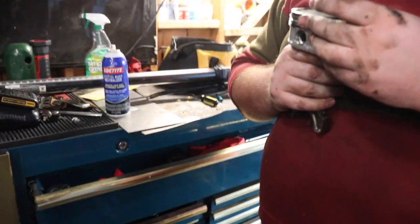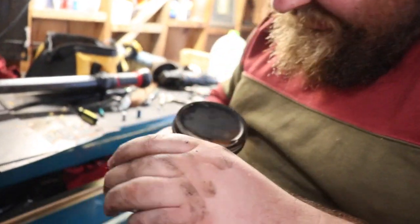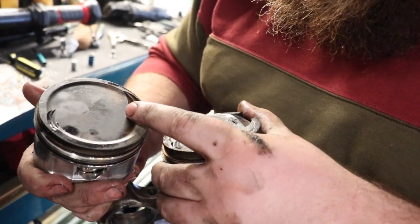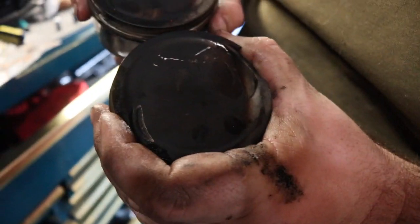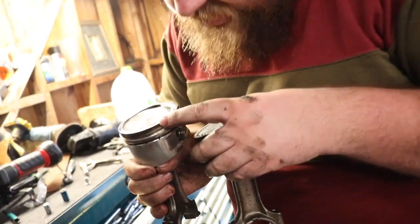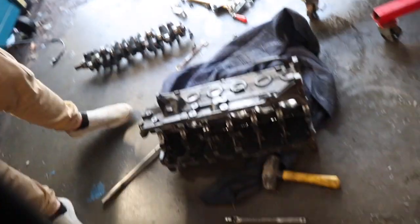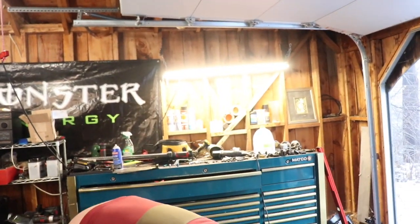Interesting — your valves had hit at some point. Are they all like that? No, see this one? There's a huge divot there and there isn't over here. This one definitely spanked up there — this is an impact mark and it shouldn't be double cut like that. That's definitely a hit because you can see the materials pushed up and there's a ridge there. Everything hit. How many times though? Probably 40 times. The pistons were probably like globs of molten metal, just stamping like a letterpress. Everything that could go wrong with a motor, it has.